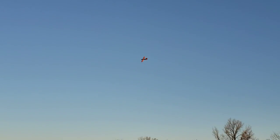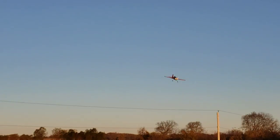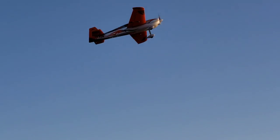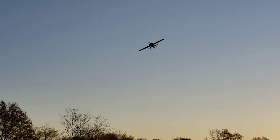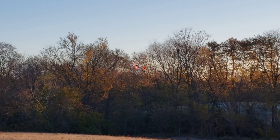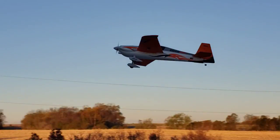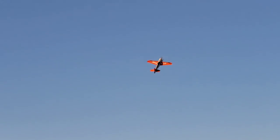You know what else you could do on this plane to make it more of a 3D extravaganza? You could put a lower pitch prop on it. I feel like the pitch on this prop creates a lot of speed that you don't really need for 3D performance, and that would get you out of the hole a little quicker too. But man, that thing looks so good with that wood prop. I think it's well tuned. That Vector works better than I expected.